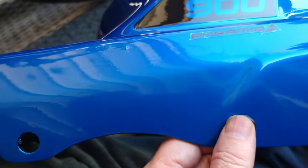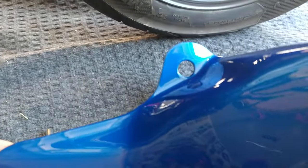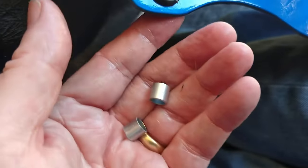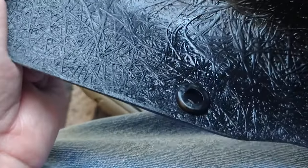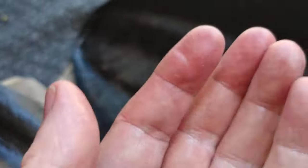If we're putting this fender and chain guard up there, I need to mount three little rubber grommets — one here, one here, and one on this side over here. I found that using a little WD-40 or lubricant really helps put these things in. Now I'm going to put these three little bushings in the rubber grommets that I just put on. I'm just going to push them in. These little bushings can be a tight fit. Once you make sure you've got your rubber grommets seated in there right, you can put a little WD-40 on the bushing — that'll help it slide in.